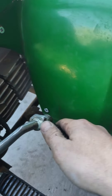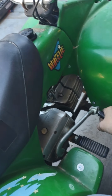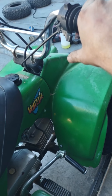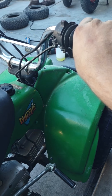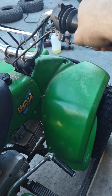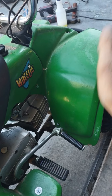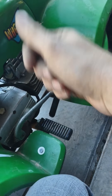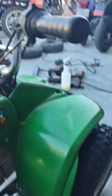The way you'd start this would be a pull — almost like a hand kickstarter but in reverse. If you're having trouble starting your bike, go ahead and pull this choke. Give it a little bit of gas, but you pretty much just want to pull the choke and give it a couple of pulls. If it doesn't start, obviously make sure you have fuel in your tank.